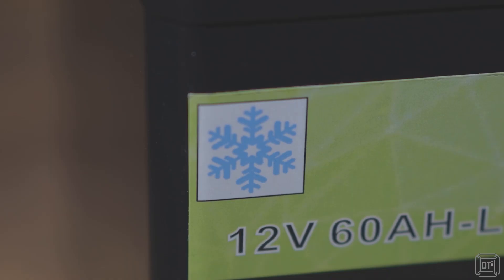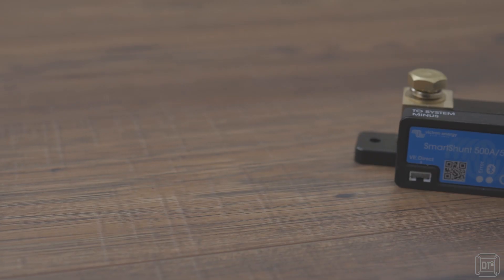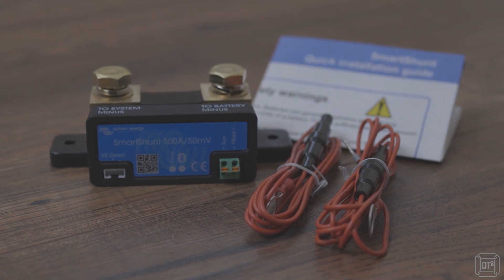It seems strange to be talking about features of a battery, but like many lithium batteries the KS Energy actually has a built-in battery management system that effectively protects the battery. One particular feature that attracted me to the KS range was that they have an integral temperature sensor. Lithium iron phosphate batteries can be used all the way down to minus 20 degrees Celsius, but they can be damaged if they are charged whilst at freezing or below. The temperature sensing of the KS means I have one less thing to worry about should the battery be in the van during cold periods. I may well purchase the optional temperature sensor for the Victron Smart Shunt as well, but with the KS Energy sensors being on the inside of the battery itself they will doubly ensure that the battery is never charged incorrectly.